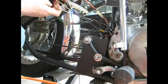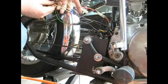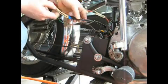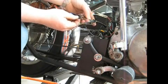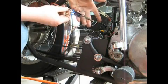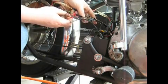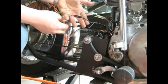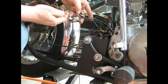There are three white wires that come out of your regulator rectifier — simply attach them to the three white wires coming out of your stator rotor assembly. To the best of my knowledge, the order does not necessarily make any major difference. Next, you've got a green wire from the regulator rectifier — attach that to the green coming from the rotor stator assembly.